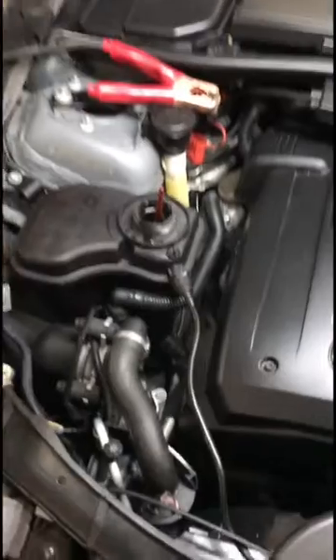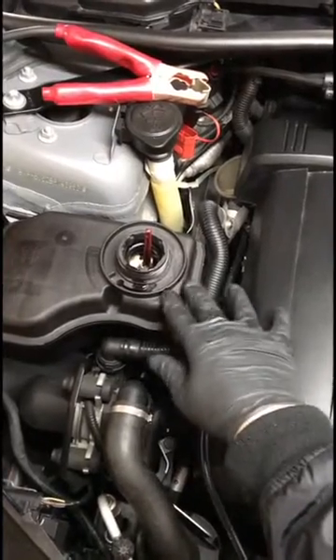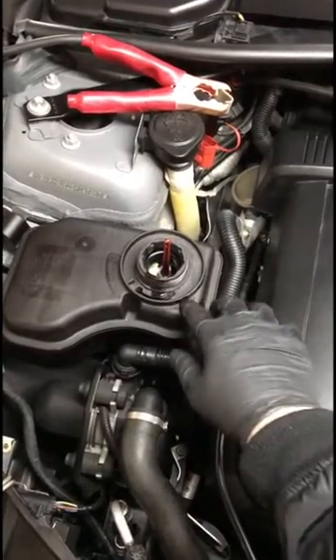What you want to do after a repair is add a 50-50 mix, loosen the bleeder screw until you hear the air bleed out all the way and this little bobber reaches the top — real easy. Then you can tighten this up.